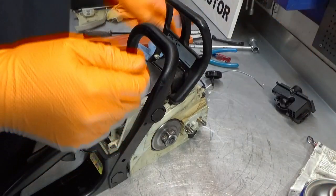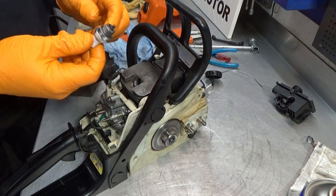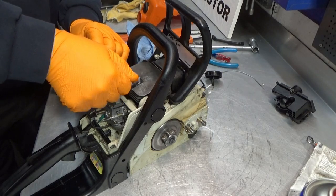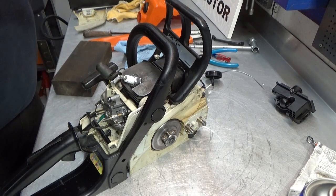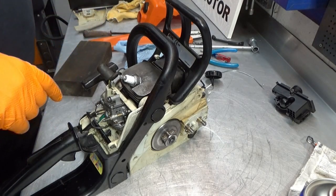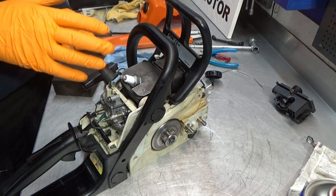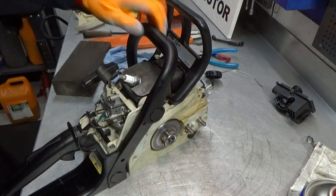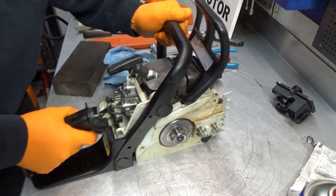Put the cap on the grease here. And put in the spark plug. By the way, how's that looking? Rather nice, actually. I found that when you run premix, you know, that alkylate gasoline, Aspen, Tri-Fuel, VP, whatever it's called around the world, the spark plug tends to run at a slightly lighter color. Regular homemade mixed gas, they tend to run a little light brownish. But with the premix, it's all 40 to 1 in this one. 50 to 1, sorry, 50 to 1. They tend to run a little lighter in color. So there's a difference somewhere.